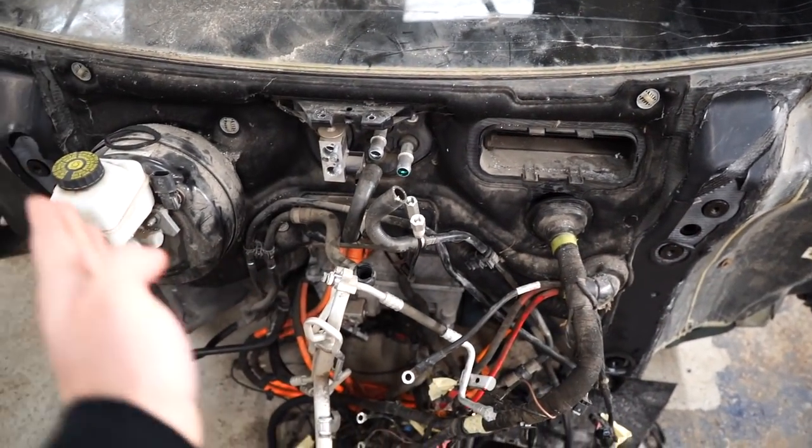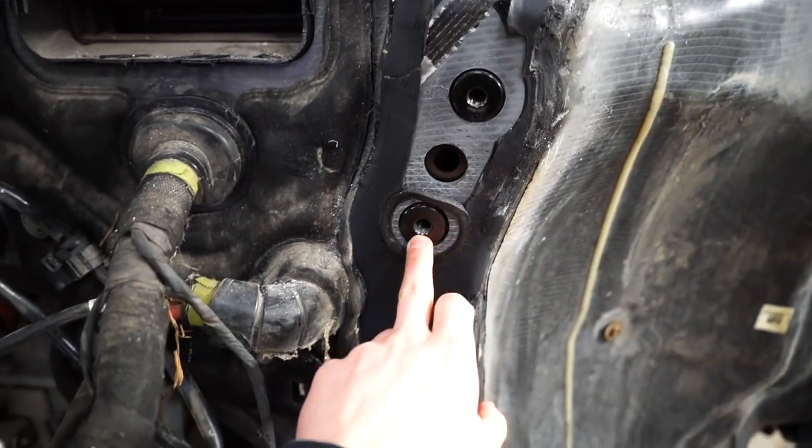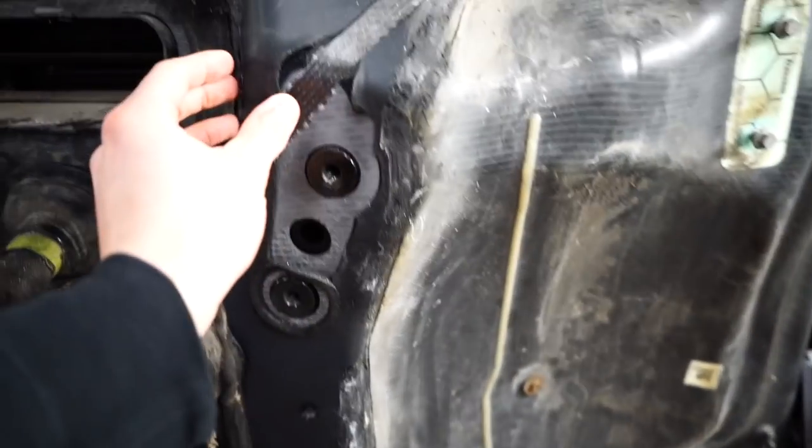That is the only way you can do it. I'll put a longer video up on Sunday's upload. This car is fully prepped and ready for the new subframe to go on. The plans show how you're supposed to remove the subframe - it was all in one piece. You have to cut the supports here, grind it off along the back, and there were three bolts connecting it which were filled with mastic. He tried to use some cheese wire to cut through it, but it was just never ever going to work.